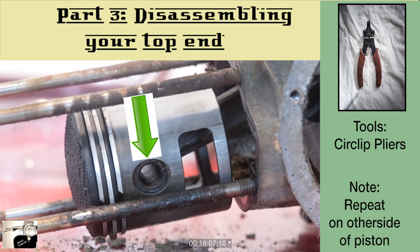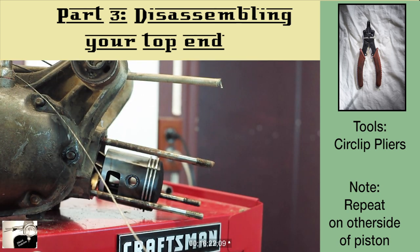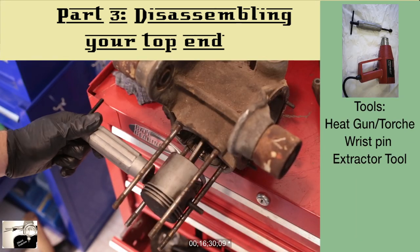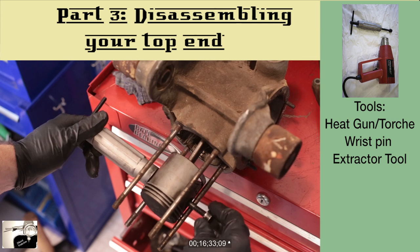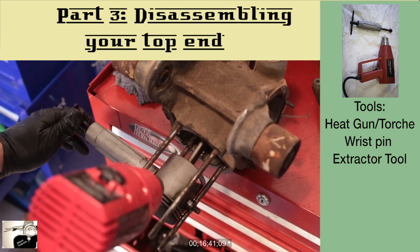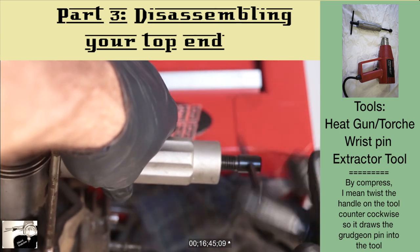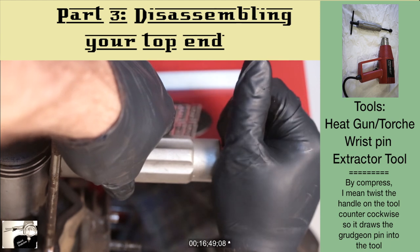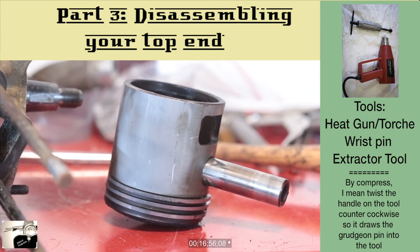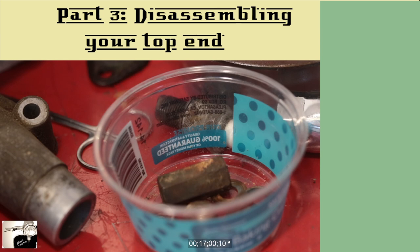Next up, in order to pull the piston, we're going to need to remove the gudgeon pin that holds it to the crank. Look for the circlip that's keeping the wrist pin in on each side of the piston. We'll want to remove these from both sides. Using circlip pliers, compress each of them and remove the circlips as seen here. Repeat on the other side. Next up, we'll want to slide our gudgeon pin out to release the piston. Start by connecting up a wrist pin extractor tool as seen here. We'll follow that up with some heat on the piston from the heat gun. After a minute or two of heat, compress the wrist pin extractor tool — it should pull out of the piston and into the tool. Be ready to catch the piston as it releases the wrist pin and crank.